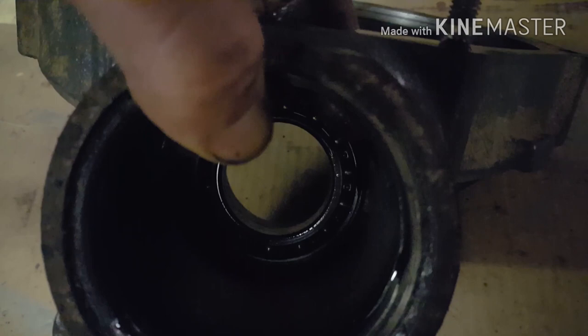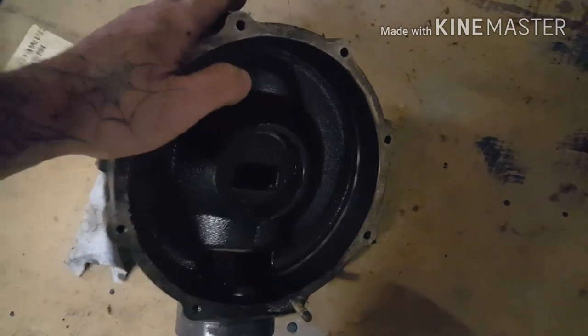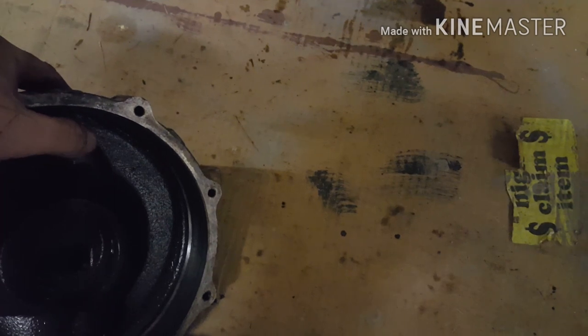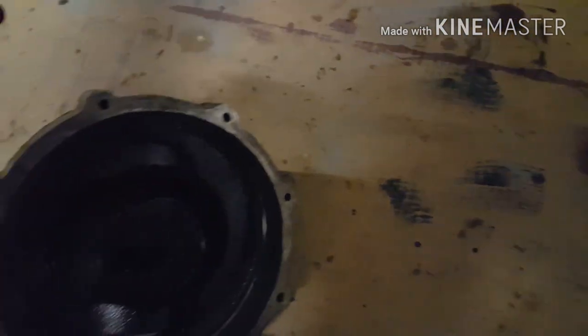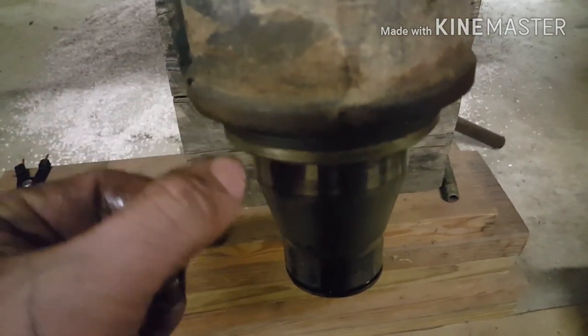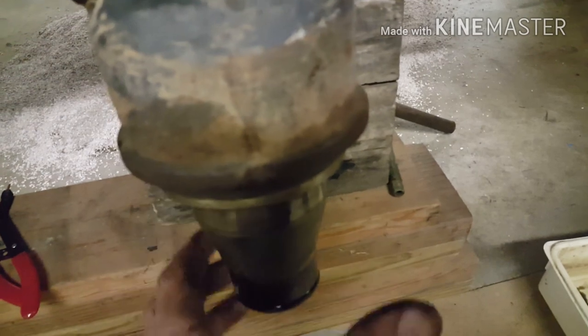Once that comes off, look up inside at the bottom and you'll see another C-clip. Take your C-clip pliers and pop that C-clip off. Once you pop it off, you can take the whole assembly off. That's where we ran into problems because it didn't just fall off like a lot of people say it does — ours was stuck on there. Take a flathead and go around this edge rim right here, just kind of pry it real slow. Don't work it heavy because you don't want to bust this rim off — just pry it and give it a little tug and work yourself around there.